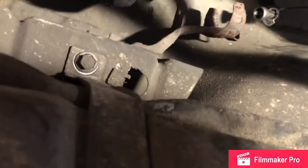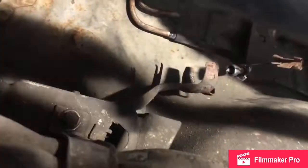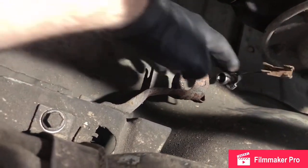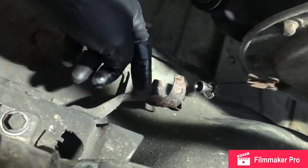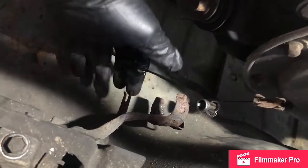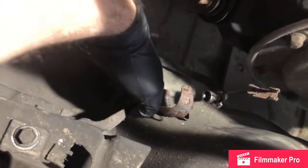I'm going to bend this tab right here back. Take this guy and just flat set the fuel filter right in here. It won't snap in like the stock one does because of all this adapterage we've got going on. Oh, there's some fuel oil dripping on my fingers. It's going to get my eye. So I'm just going to get a steel hose clamp and hose clamp that filter right about where this thing is, so that it makes a connection with the ground and is secure.